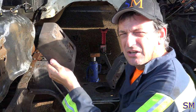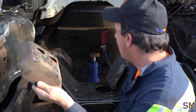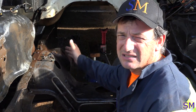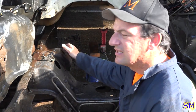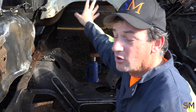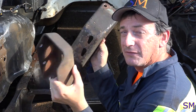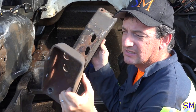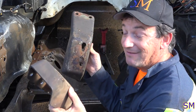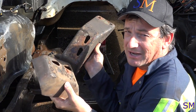So he wanted to do a 460 swap as well as I did. Unfortunately, he couldn't, so I was able to buy it off of him. If you only have the 400 and you're converting it to a 460, you can buy the adapter plates. They're a couple hundred dollars, not cheap, but you can simply adapt this to a 460, so all your transmission stuff in the back will all button up right up, no problem. However, with my donor engine, he actually had the 460, and they only bolt up to the 460 on the bull noses, these ones do. I was extremely fortunate to be able to actually have these, so all we gotta do is rip out the old perches, bolt up the new perches in, and it's just regular engine mounts.